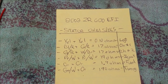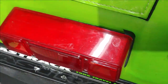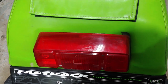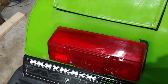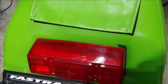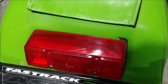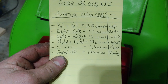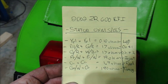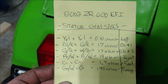I'm not sure if both headlights and taillights have to be out for limp mode to trigger. I do know the taillight on this sled has a crack — the trim is basically missing — and I haven't really paid attention to whether or not the brake light is working. I know the low beam works for the headlights, but I don't have bulbs for the high beams, so I'm going to harvest those off my wife's other sled and install them. As long as all the stator specs check out, I'll go from there. If everything checks out, I'll suspect the ECU is bad and get a new one.